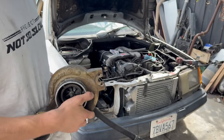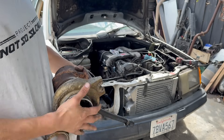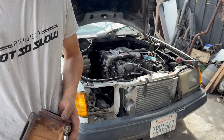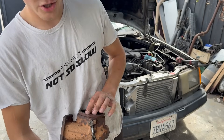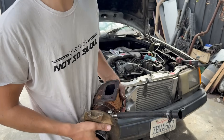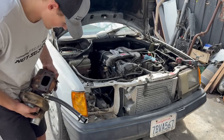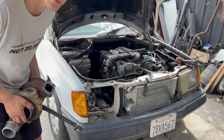Since this turbo is not going back onto a Cummins, I had to twist apart and move the front housing and the rear housing oil feeder and oil drain to fit correctly. Now that I did that, the wastegate no longer lines up. So I'm just using a clamp to clamp the wastegate shut, and then the wastegate system will just be our external wastegate that we installed. This should be as close to the same situation as possible.